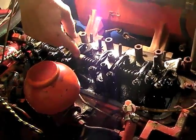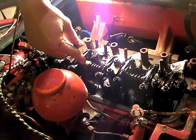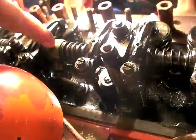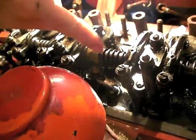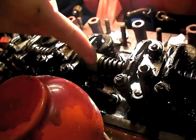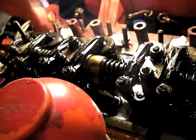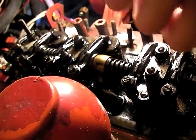This is your oil feed line, and there's a hole in this, and there's a ring in this, and there's a hole in the shaft. You have to make sure that this thing is lined up properly or you won't get oil — the oil won't move out to the ends of the shaft and lubricate these things.